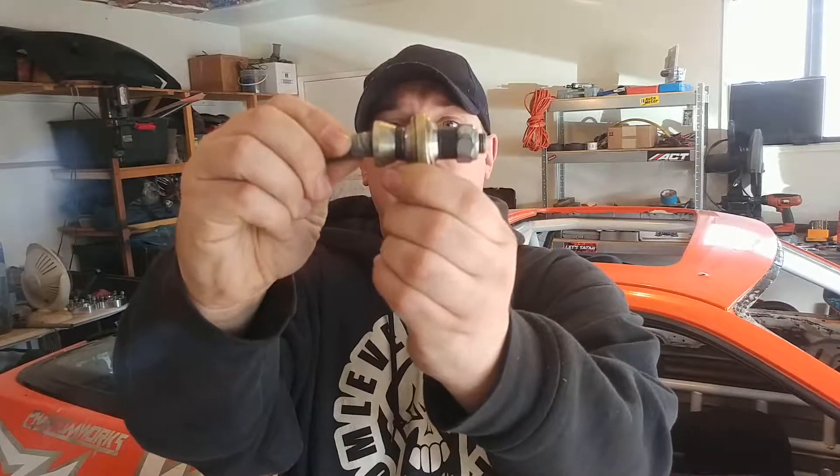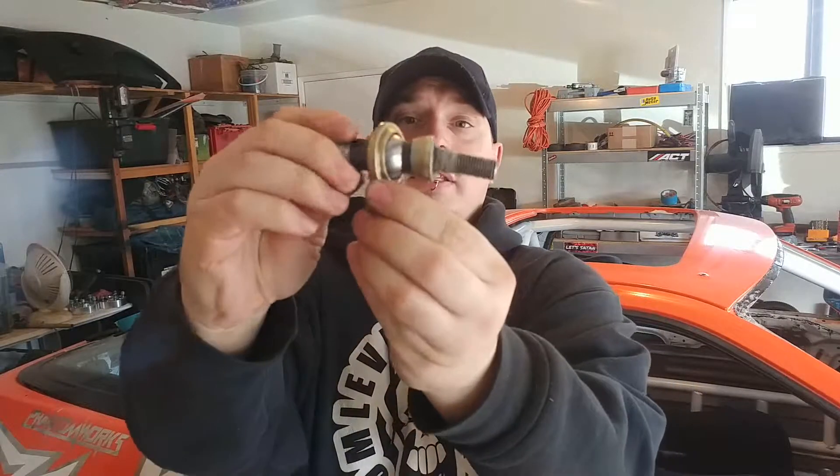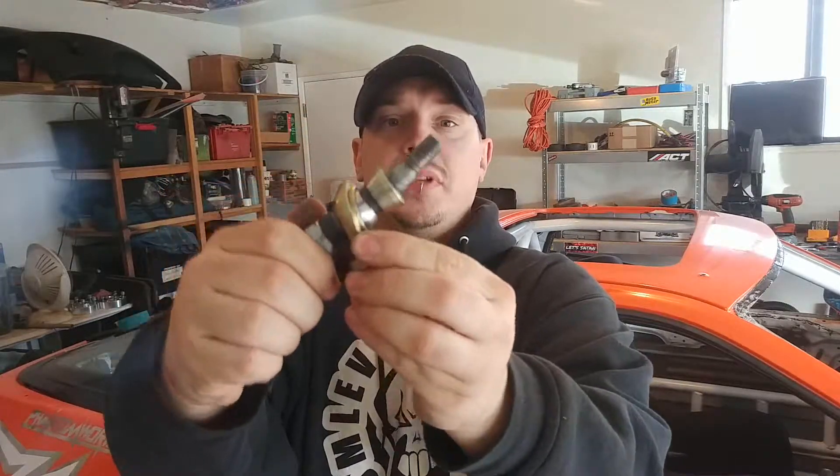I took a break from the wiring today to finish the front suspension, put those lower ball joints in, put it on the ground and check the clearances. Even though we checked clearances in the last video, when you actually load the suspension that changes everything. I wanted to make sure I didn't have to order any parts — but come to find out I do. You can see that's pretty wiggly, and this side is definitely not good. This was the side I hit Travis with, so I kind of suspected there'd be damage there.